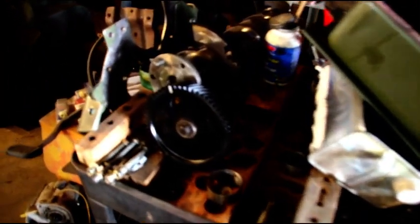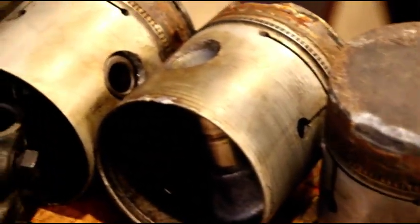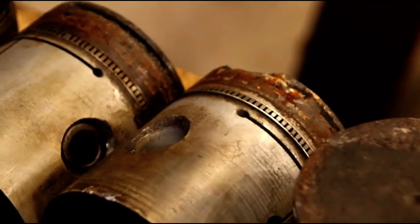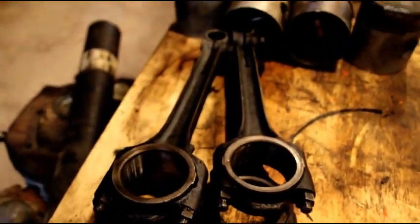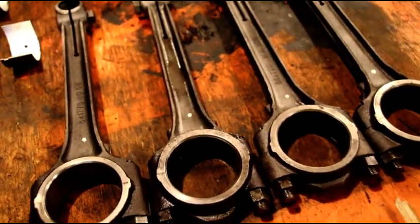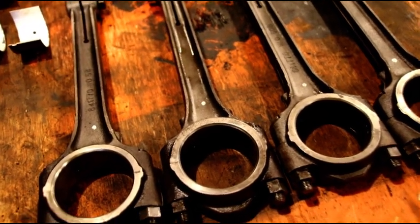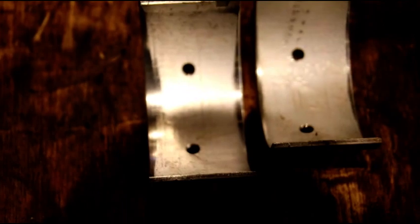Back in the shop — you're looking at Hal's original pistons that I pulled out of that engine. They're in horrible shape, the rings and rust are just terrible in there. I got them off the rods and Hal's rods need to be resized. I'm going to do Hal's rods along with Gary's rods, because Gary's worst one is two and a half thousandths too big. Just think about what that would do to your oil clearance — you'd be hearing a knocking in no time.